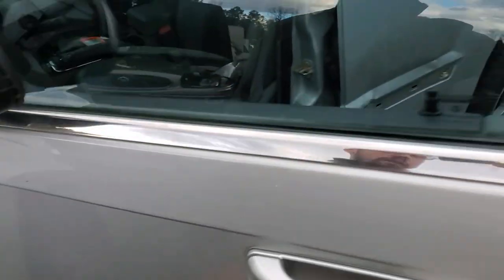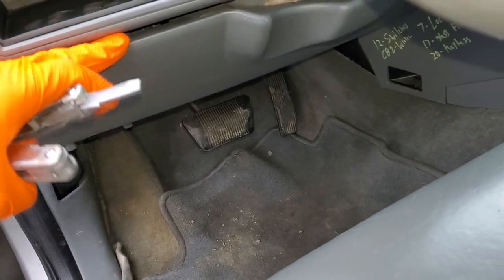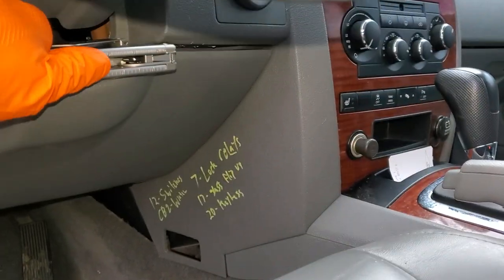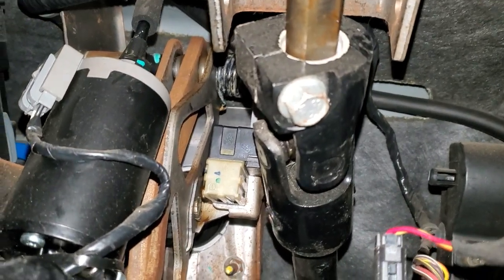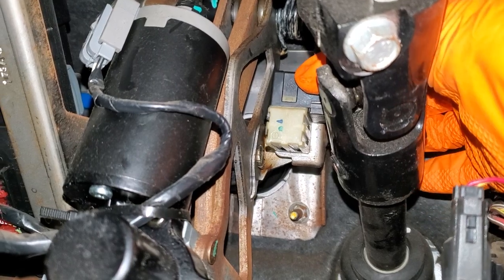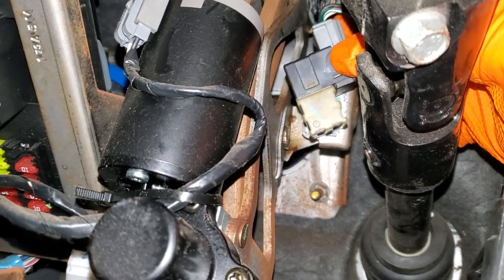Let's head back in the car — I'll show you how to get to that switch. You're gonna pry on this piece to get it to come out, and sometimes you have to pry over here as well, or you can just grab it and yank it down to get it out of the way. Looking in here, there's the brake light switch right in front of us. I can reach around the steering column and put my hands on it. To remove it, I need to rotate it to the left counterclockwise and that will get it to come out.